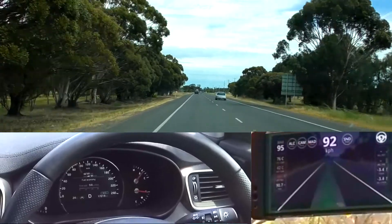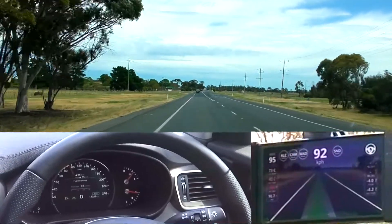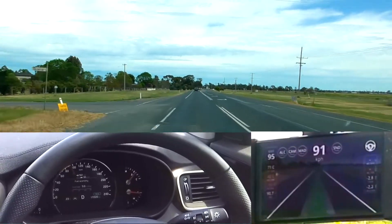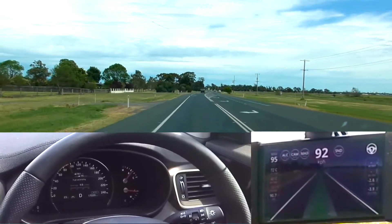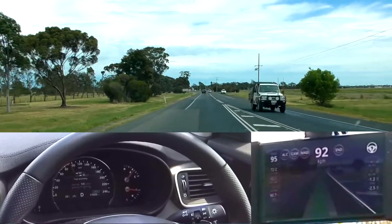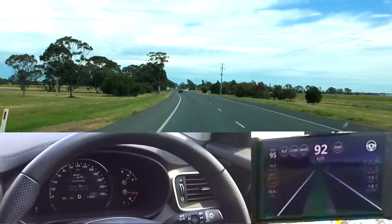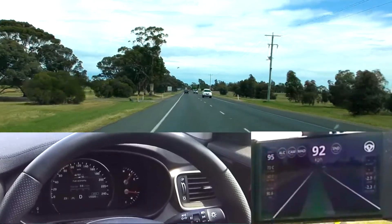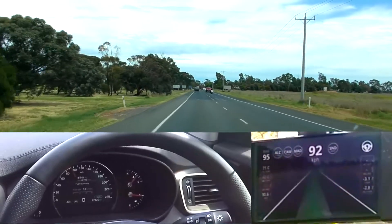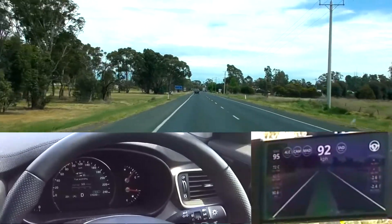It always works, which is kind of the idea behind it, and it's still just as easy to kill - just hit the cruise button and steering is killed. It's just that hitting the brake button doesn't kill it. I'll be pushing this public very soon. There is one bug I haven't found yet - if you have CAM enabled and only CAM enabled and you're at a standstill, occasionally it'll throw up an error on the dash about the lane keep assist, the factory lane keep assist. But it's rare - maybe if you're sitting there for two or three minutes it might pop up once and then it goes away. It doesn't happen when I'm on the road, and it doesn't actually affect the operation.